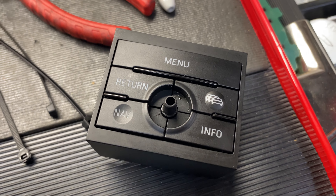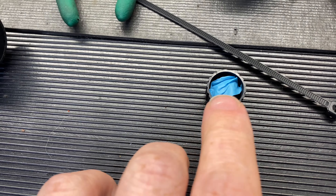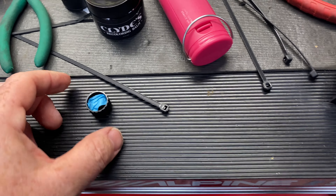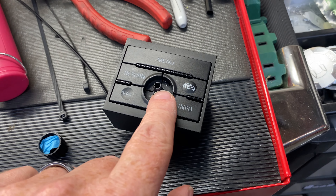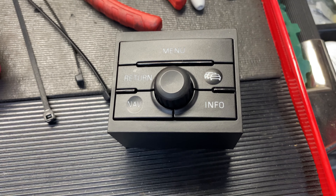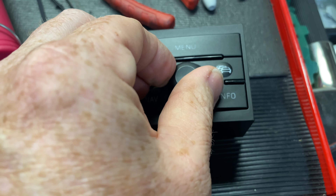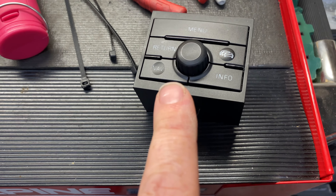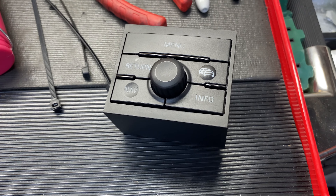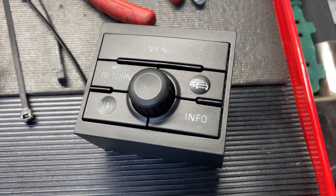Okay, I've got it pretty much as clean and functional as it's going to get. It does turn — it's still pretty stiff — but I used a little friction modifier: just a small section of a latex rubber glove from the garage. I put that on there and it gives just enough grip around the shaft due to the wear, so it will function again. And it does in fact work now — you can see the clicks. A little section of glove in there did just the trick. I could have glued it, but this keeps it clean and allows me to remove the knob in the future if I want. Thanks for watching.